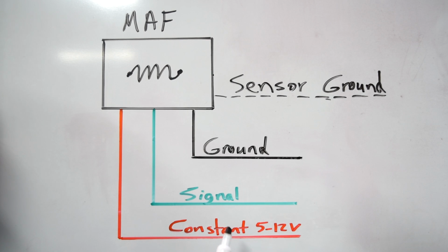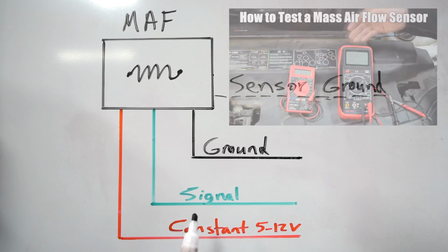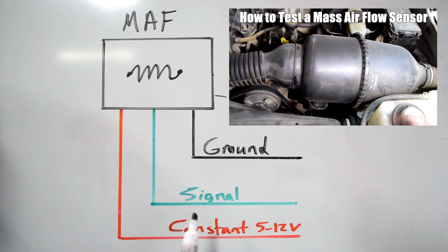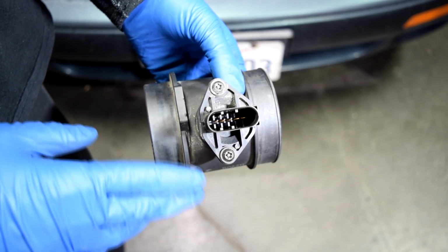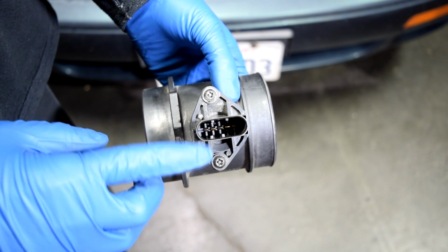Now, with a basic multimeter, you could test your MAF sensor for ground signal and voltage to see whether it's doing what it's supposed to, but that's only going to work on MAF sensors which have a DC voltage output as their signal. Some MAF sensors use a frequency output, and for those you'll need a lab scope, but a lot of the older cars, they do use a DC voltage output. And if you're wondering how to do that, I'll put a link to a video I did recently at the end of this video that you can check out to see how you can use a basic multimeter to test your MAF sensor. But just to go back a little bit,